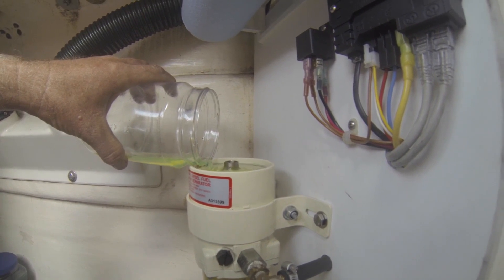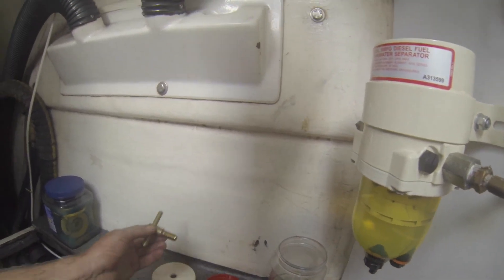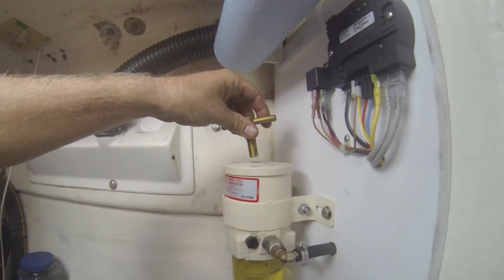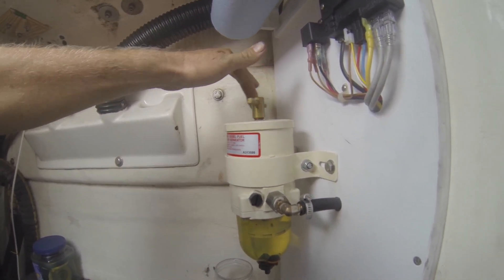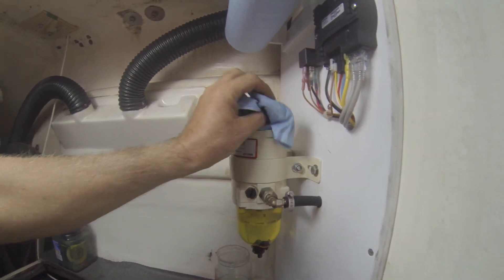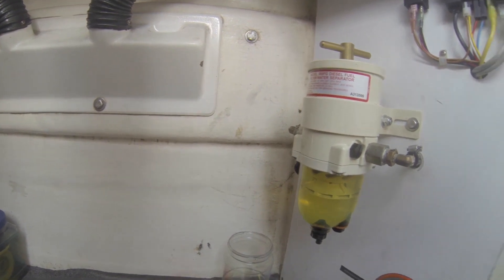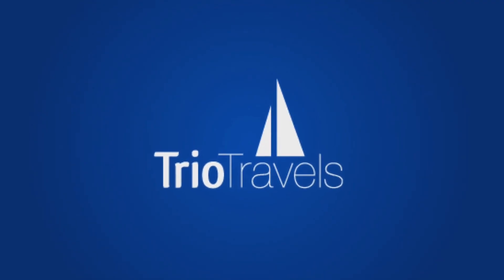So we take this diesel and we're going to pop it up so that the fuel flows all the way around the filter. Because if we didn't, it wouldn't rise any higher — the filter would never ever get used. Perfect, right to the top. I've changed the two o-rings — the red one here and the dark one here. Looks like I filled it a little full but it's okay. And that's that — now we just have to dispose of our ugly black filters.